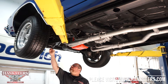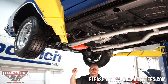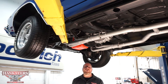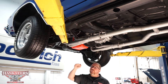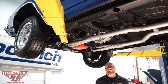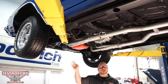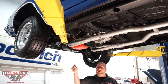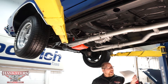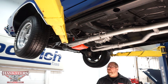Steering is a power steering car. All of our tie rods are good and straight — the ends on the tie rods are all in good shape. All four rubber dust boot covers are intact all the way around, which tells you it's been greased and maintained, keeping dirt and debris out. As far as the rest of the suspension, shocks and springs are pretty much your stock setup. Power brakes with disc brakes up front and drum brakes on the rear. The wheels are 15-inch JEGS polished aluminum five-spoke style with JEGS center caps. Tires are Cooper Cobra radial GTs — 235/60 on the front and 255/60 R15s on the rear. Tread is all in really good condition.